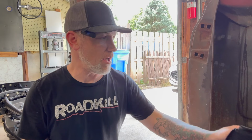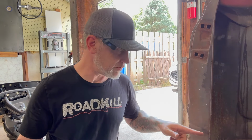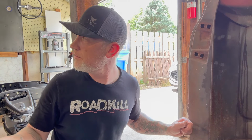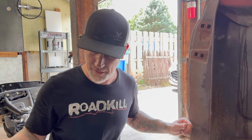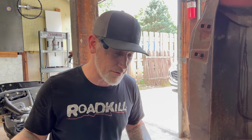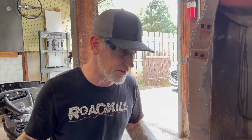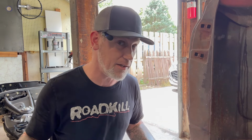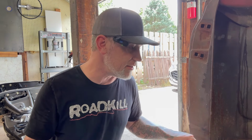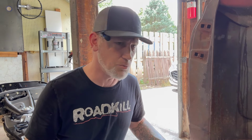So good. But I have bolt supports. I have this pillar. Man, I really thought I bought the other one, but I guess not. So I'm gonna have to get this. I gotta get a rocker, and I might just get away with an inner rocker instead of doing the floor extension they sell, which is really nice if you need it. Highly recommend, 67 through 72 C10 guys. If you got some rot going up the floor, it is really good, and it is worth it. It couldn't have been more than $130. It's worth the $130. It saves you a lot of work.